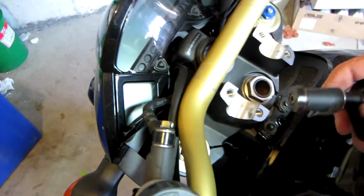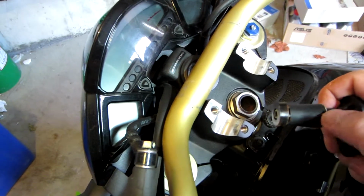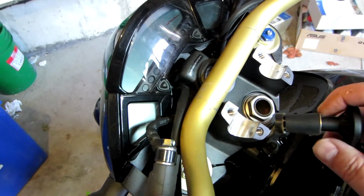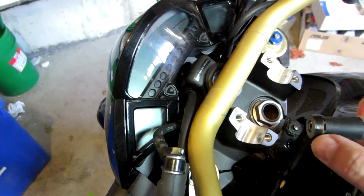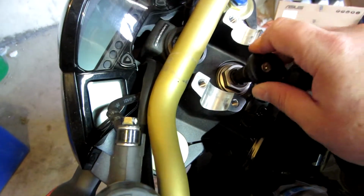All right, so we got everything measured. Basically what you want to do is measure to the widest point of the expansion tube and then cut it there and then cut 1 inch down. Then you're going to match it with the washer that matches the top of the tube, and then that nut gripping piece at the bottom. And now we have a pretty snug fit into the tube.